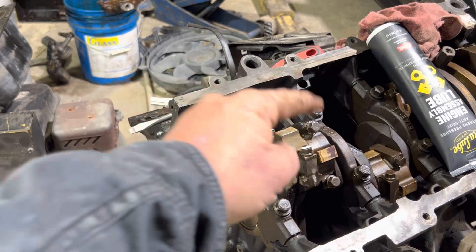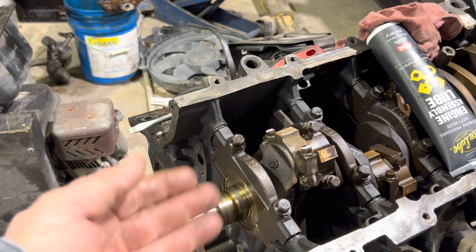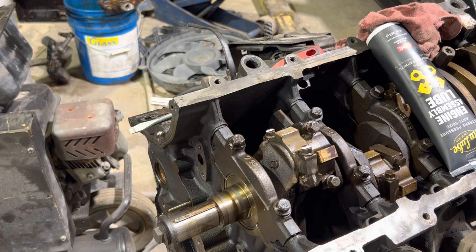First rod cap's done. I'm going to go ahead and do the rest — I'm not going to make you watch all of that. That's the step of swapping out your bearings if you're not pulling your pistons out. Just make sure you've got everything good and clean when you go back together. Use some assembly lube, new bearings of course. You're supposed to use new bolts — I'm gambling here; it's my money, my labor. If paying somebody to do this, I'd probably insist to use new bolts.